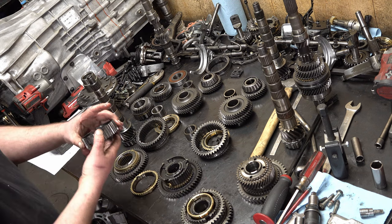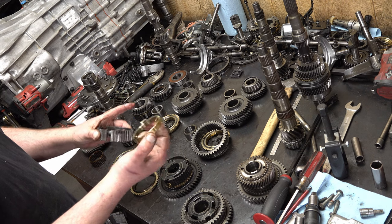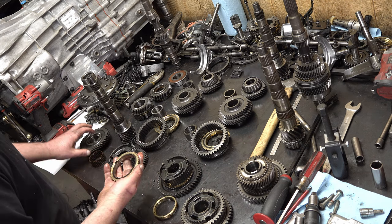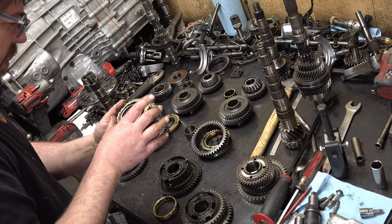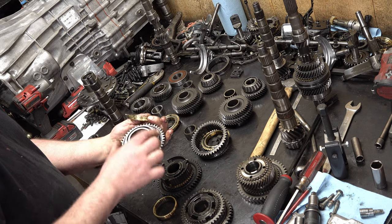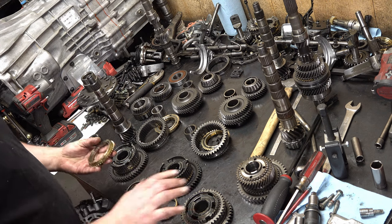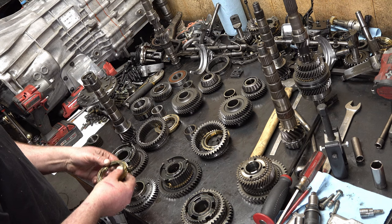That gives the brass part of the synchro these three lugs — it doesn't take as long before it engages. I don't know why they made the slot so big because it makes it so that this element doesn't engage. Frankly I'm willing to believe it doesn't engage at all, because if you look in here there's literally no marks from that synchro, and brass will generally transfer a little bit to steel. So I think that part of the triple synchro was just not being used, and this part here was effectively acting as part of the gear — just like any other single synchro gear except with a little bit of slop. So I'm going to use the first and second out of an E350 and put it with the rest of the stuff from the E56; the ratios are exactly the same so there's no problem there.